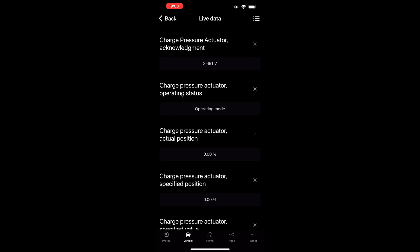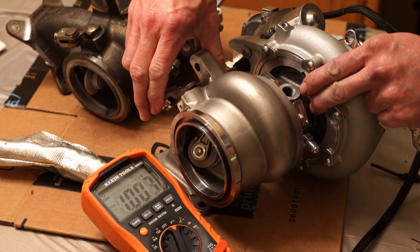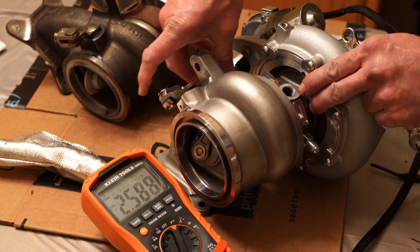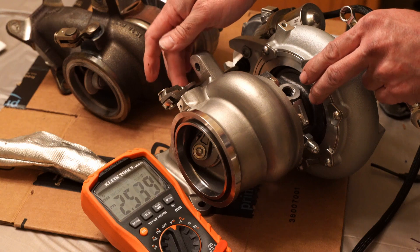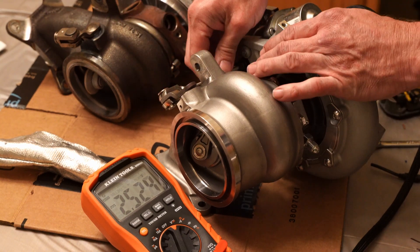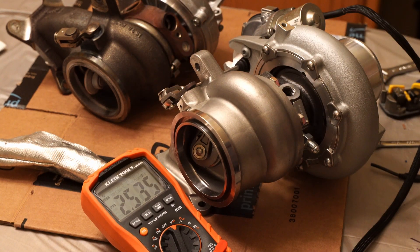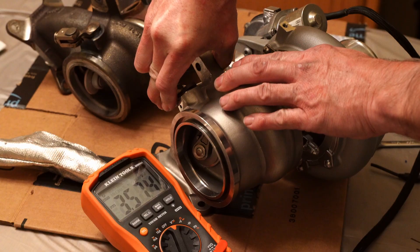There are some ways to manually force it closed without the engine running using OBD-11 or VCDS, but it wasn't necessary for me since I bench adjusted it on the table. If you have an IS-38, you can get that extension cable from CTS Turbo — that will allow you to plug it into the car and plug the turbo in nearby on a bench, turn on the ignition, and use OBD-11 to read the voltage as if it was installed in the car, but it's not. Hopefully this helps those of you looking to bench adjust an IS-20 turbo wastegate actuator.